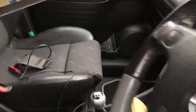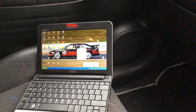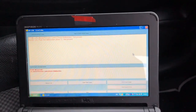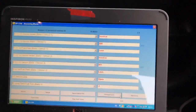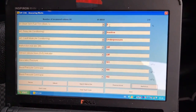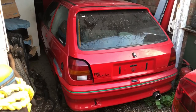We're going to plug the Opcom in because I've got a slight issue with the EML light coming on intermittently. I've got a good old Cosworth on the laptop. These are the two codes that are coming up - very simple to sort. The fuel trim is probably down to the spark plugs anyway, just an issue with emissions - the fact that this has got a decat as well. I've erased all the codes now. Long-term fuel trim is absolutely spot on at minus one, there's no problem with that. Short-term fuel trim is spot on too. The plugs were causing an issue with the fuel trim - the O2 sensors were working out that the spark plugs obviously weren't burning the fuel properly.